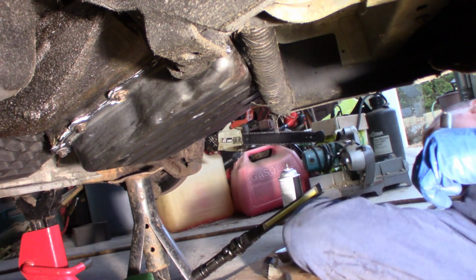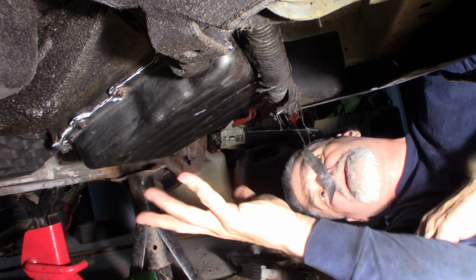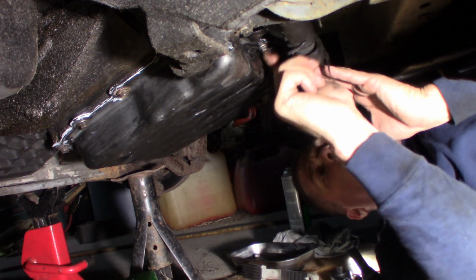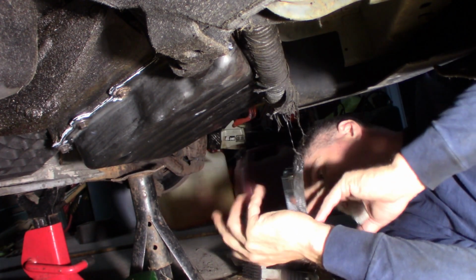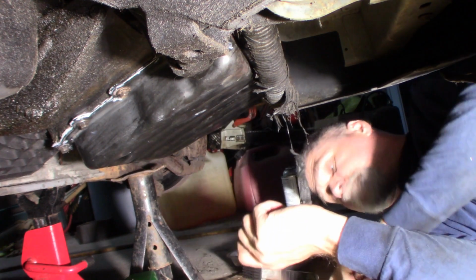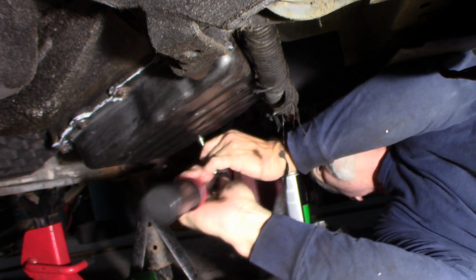That's my last one. All right, you just missed me fighting with it. I'm going to finish torquing. I got one set around at half the torque. I'm going to go up to 15 foot-pounds now. I had another one that was messed up from before, and I had to mess with it and chase it out and make sure it was clean, but it looks like it's good right now, so we're going to do a final torque on these. Let me get my wrench set here.